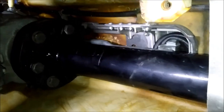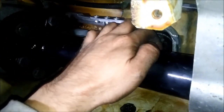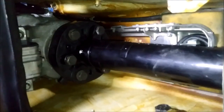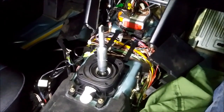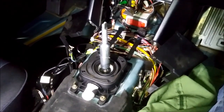One last view from underneath — everything is in place now. The connecting rod has approximately six to seven millimeters of space to the prop shaft. Everything fits and I'm pretty happy with how it worked out. So now you know what to change to fit the newer gearboxes into your 202. Thanks everyone for watching — I hope you enjoyed it and found some valuable information. If you want to support the channel, like and subscribe — I would appreciate it and see you in the next video.